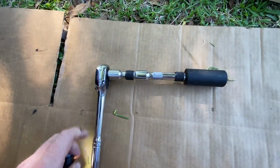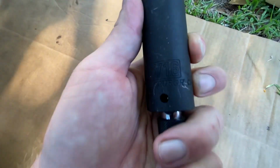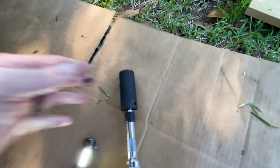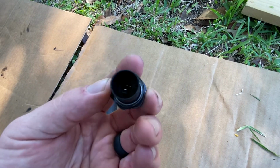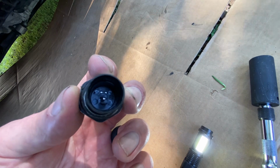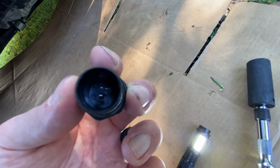So you will need to remove your splash guard. Your tools required will be a 1/2-inch socket. I use these two extensions, and it calls for a 24 millimeter, but I have a 15/16 that fit just snug. If it is failed, the telltale signs, here's the old one, are going to be oil basically on the inside of where that prong is if it's failed.